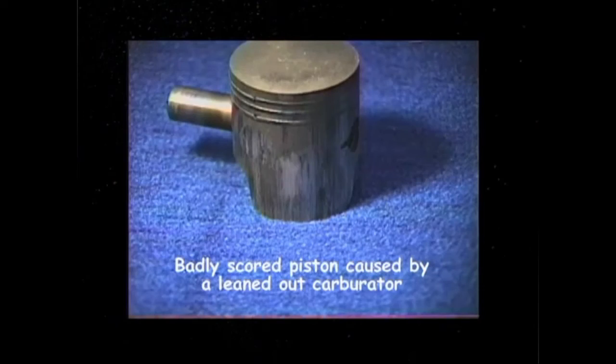This piston right here, take a look at this piston. And what we can see is that the piston has a lot of score marks on it. And the rings are seated right into the piston lands. And what has happened is that the carburetor that was related to this piston had leaned itself out, making this piston run dry in the cylinder. Now, the owner should have known he had a problem with his outboard engine, because this would have showed up very easily when he started his engine up